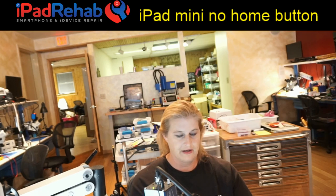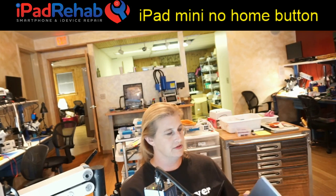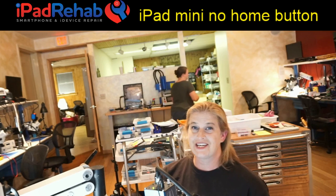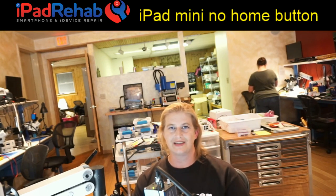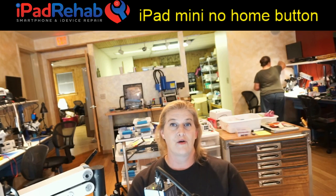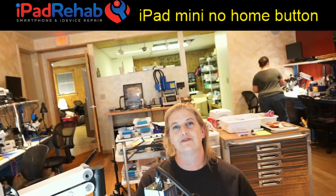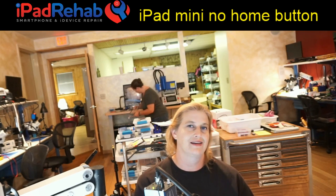Parts issues can control you. We did a video on the iPad mini where the top power button doesn't short press - that's a parts issue from a problem at the home button soldering connection on the screen. And here we have no home button on the original iPad mini, which you can be tempted to think is always a parts issue - just keep trying parts. But it's not always parts. You want to look at the board and develop the skill to recognize a genuinely missing component as opposed to a no-stuff, never-was-there component.